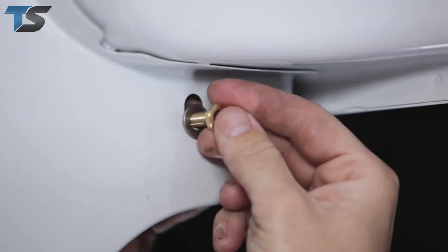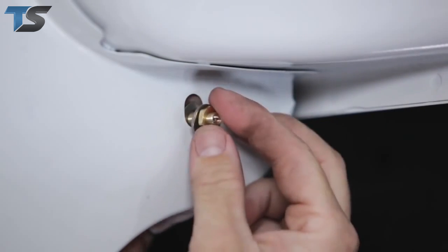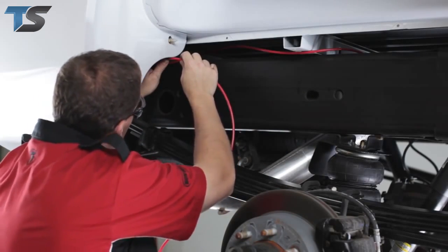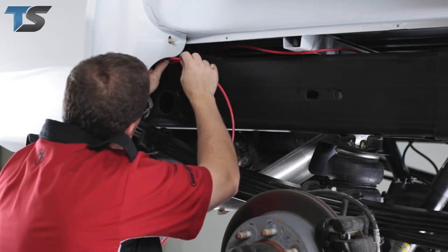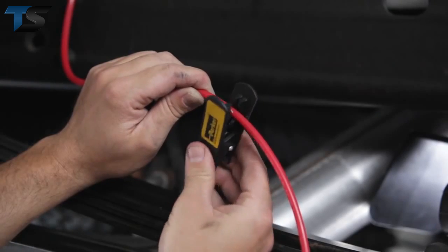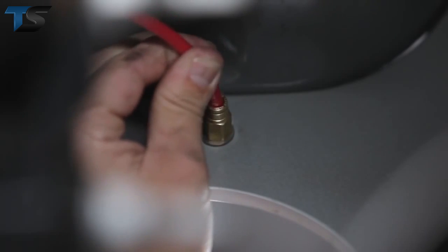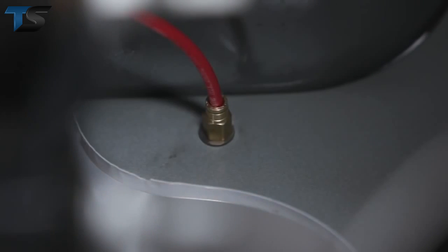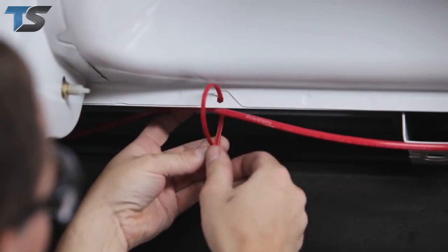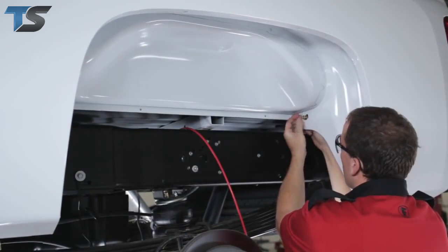Use the provided washers and nut for installation. If necessary, you can drill a 5/16-inch hole for mounting. Now run the airline tubing from the air spring to the valve, routing it so it will avoid direct heat from the exhaust pipe and any sharp edges. Cut the airline to fit using a tubing cutter and insert the end into the air inflation valve, pushing the tubing into the fitting as far as possible. Secure the airline tubing in place with the provided nylon ties.